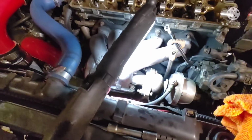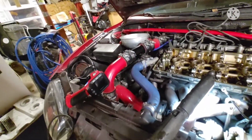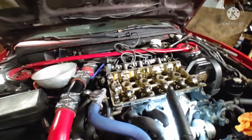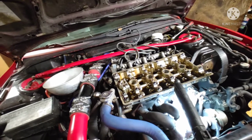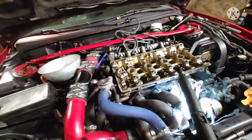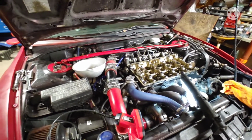So I'm going to go ahead and finish taking this apart. I'm going to take it all apart. As abused as the motor is, I think it's really going to be a waste to put a nice, clean, brand new head on, when I should at least go ahead and put a set of rings, rods, and mains in it. I'm going to get the block checked, I think, the head checked. It's not going to be now, though, so I'm going to get it tore apart.